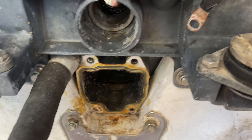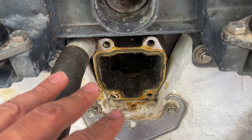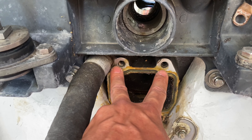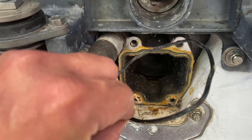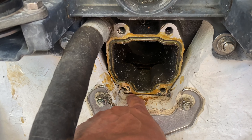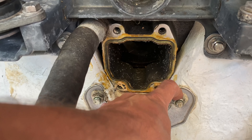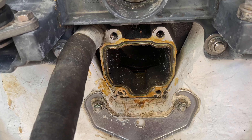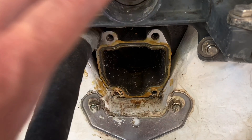If you notice, there's no exhaust hooked up here — you can actually remove the motor and then forget that the exhaust is kind of still in this area. You've got to pull the exhaust off too, unfortunately. It's held in by two bolts. While you're removing the exhaust, make sure you put a new gasket in there — this is definitely a must. If you do get leaks, it'll constantly leak right in this area and cause issues with your transom. Now, notice I didn't say anything about removing these two nuts. If you leave these two in, you won't have the transom plate in the back fall off, which is important. This will actually keep it in place. Whatever you do, don't mess with these, but you can pull the rest of it off.